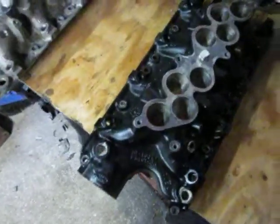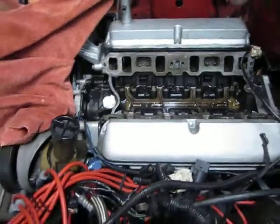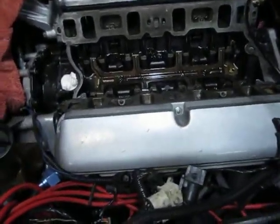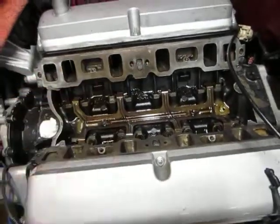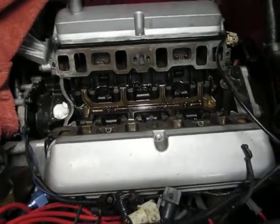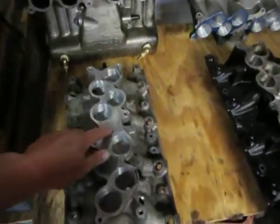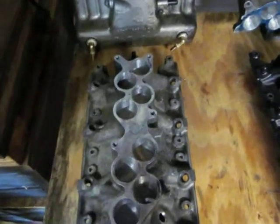So that's that on the intakes. These are the ported heads going on here. I know they look ugly, but they work pretty decent. I packed the EGR port with some steel wool to try to keep some of the heat out of the intake. This intake that's going on has the external EGR, so there's no heat going into the upper. Blocking the EGR port is helpful.